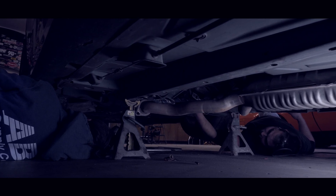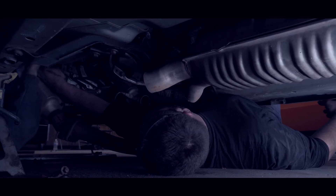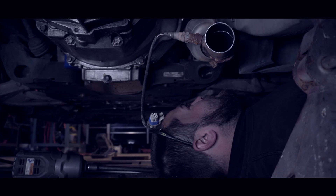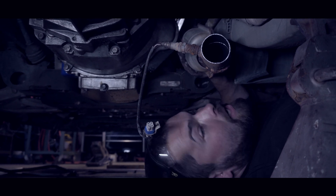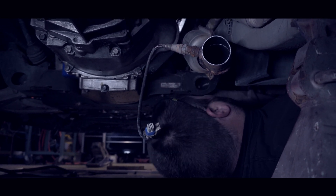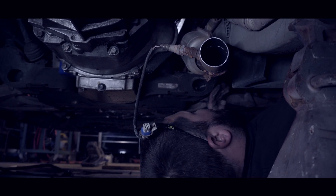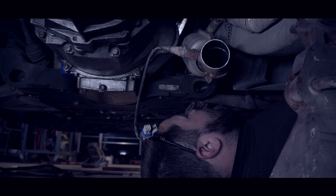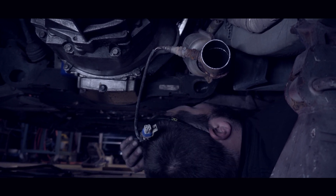The problem I'm running into is I don't think the engine will come out without undoing the catalytic converter, because it's pretty wide and really close to the frame rail. So we're going to try our best to get these old rusty bolts out, and if not, my friend the Sawzall comes back to play - safety first.